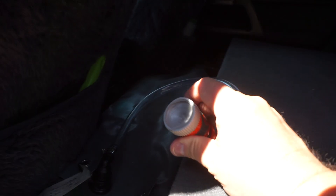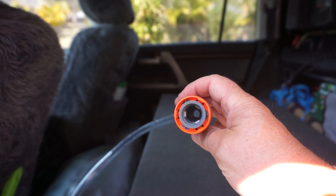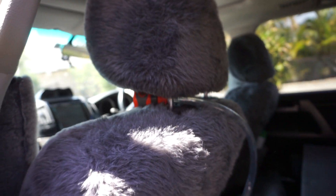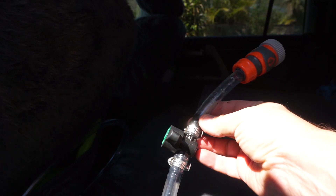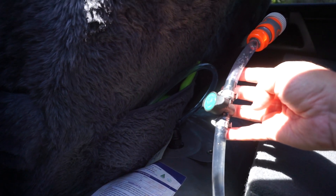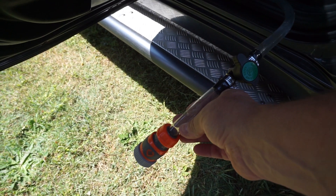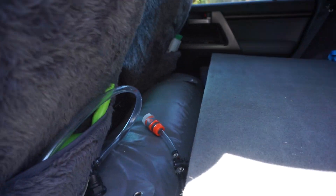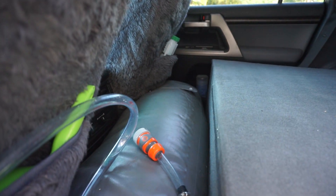When filling there's also an air breather that sits on the top of the bag. Pop that blank out of there — it just allows air out of the bag as water enters and displaces it. Pop it up behind the seat so it's nice and high, and don't forget about it, otherwise your passenger's seat gets covered in a puddle of water and she will not be happy. When I'm in remote areas and water is an issue, I'll decant out of the bag in 20-liter aliquots. When the jerry can's empty I'll simply fill it up to the 20-liter mark from the bag. That allows me to keep track of what volume I've got left in the bag, which is really important for water management.